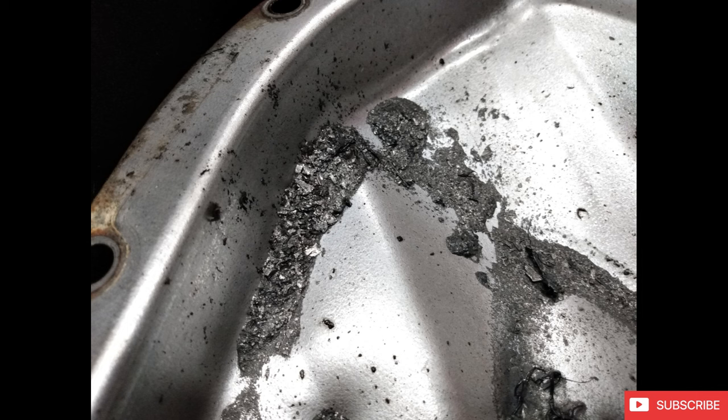Going forward, the methodology that I take with LS swaps as far as custom mounts and transmission mounts, I have this old scrap LS1 block that had a bunch of damage to it, and also this bare 4L80E case that also is missing a chunk, as you can see. This stuff weighs way less than an entire engine and transmission, so it's a lot easier to just slide in the engine bay and mock it up in there. But with how easy it is to get into the Crown Vic, you don't absolutely have to have this.